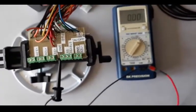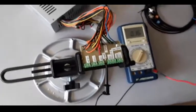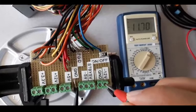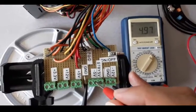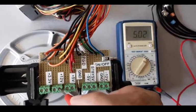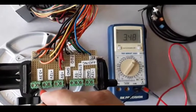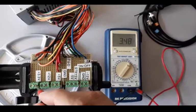Definitely running. I've switched out the negative lead so I can test the different voltages by multimeter. Let's see what we've got: negative 12 volts, standby power — which is always on even if I flip off the switch — minus 5 volts, and the power good signal, which is a logic level signal that tells us whether the power supply is operating. Also notice the positive 5 volts, positive 12 volts, and positive 3.3 volts don't have a particularly great tolerance, because there's not much load. When these aren't delivering much current — in this case almost none — they're not particularly precise. That will improve once they start to deliver some power.